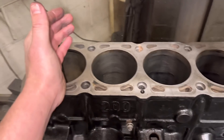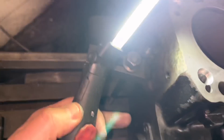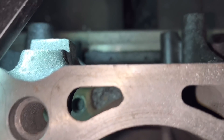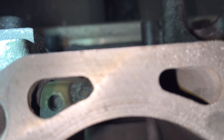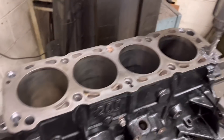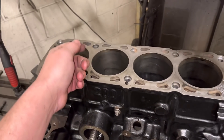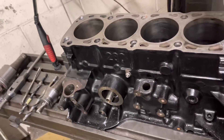The problem you get is on these back two here — this is the opposite end to the oil gallery. You've got a stud machined into a lug in the casting down the base of the block, and the same on that one. But the problem with those studs that people used to fit — or some still fit — is it just doesn't go deep enough. It basically just locates in the casting of the block, and the problem people have had in the past is it breaks that lug off.